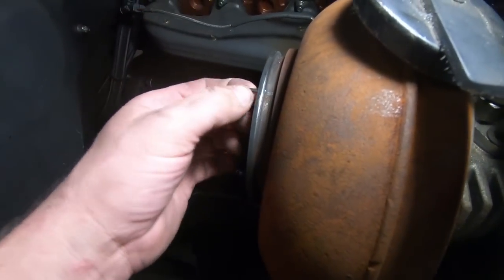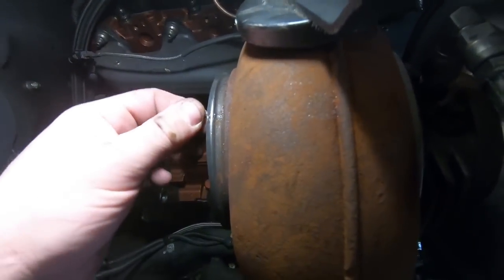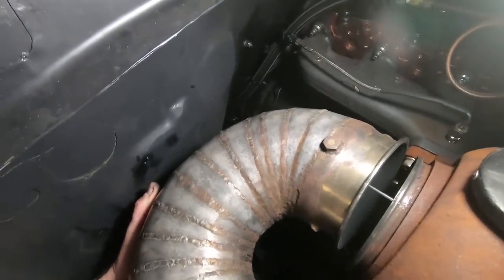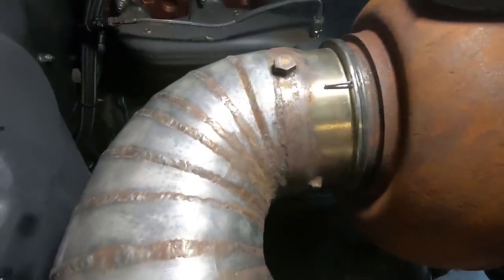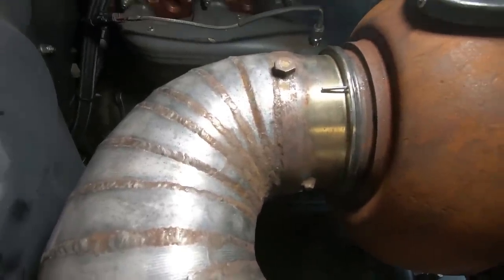I picked the dowel method. I marked it up real good and got a roll pin — as small as I could get, about a hundred thousandths roll pin. As you can see on our flange, everything's good there, it does go through the backside. I'm going to attempt to weld that up and then take our grinder and clean it up so a V-band can hold it and we don't get any exhaust coming out of there. I also drilled a corresponding hole on our exhaust pipe which we just line up — and we should be good to go. Our dowel is in, our exhaust pipe's on. All we need to do is put our V-band on. We'll cut that dowel down, weld it first, make sure everything goes good there, then get the roll pin cut down and get this all sorted out.